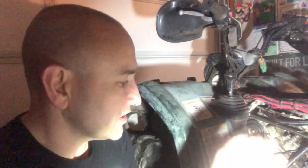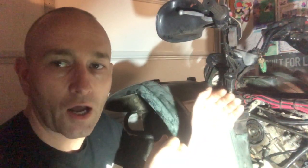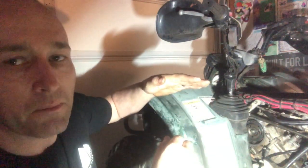So what I did was I took the crank cover off, I took the cam cover off, and in the crank cover there's a little hole, and etched on the flywheel there's a mark. One is marked F and one is marked T. Now the T, there's a little sight window on the crankcase that you line up that timing mark with, which is top dead center. So that is telling me the piston should be at the very top of its travel. That's when it's right at the top of the cylinder, which would also be the top of its compression stroke.